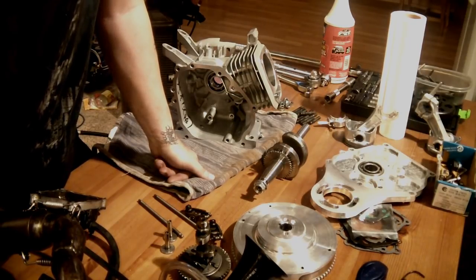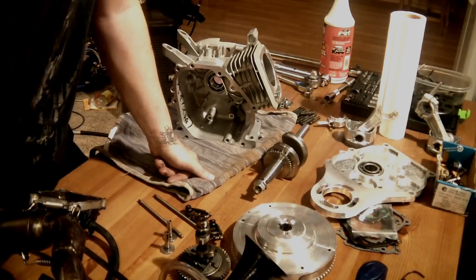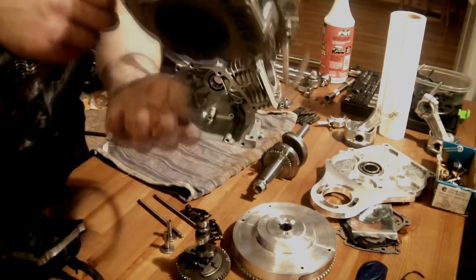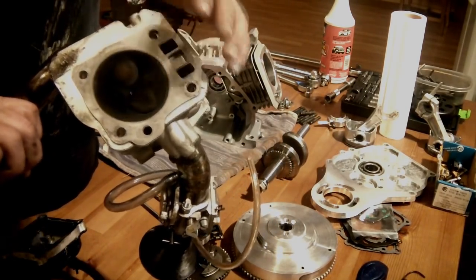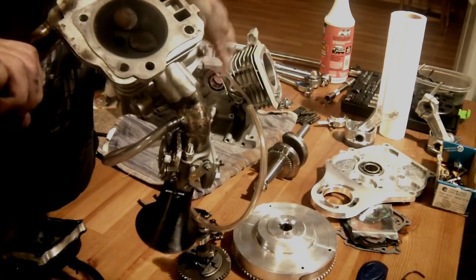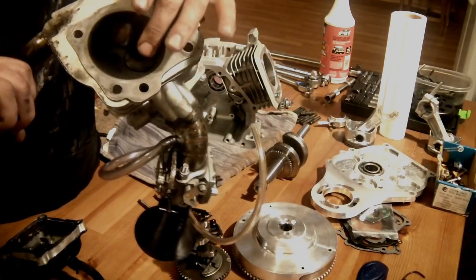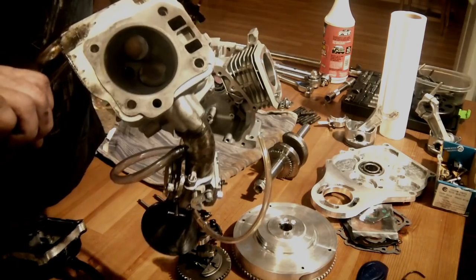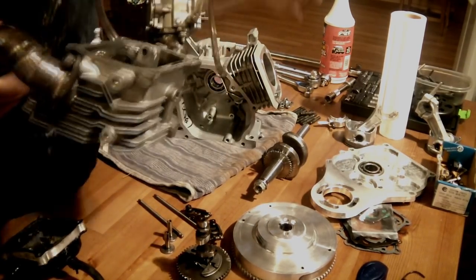It is more difficult to work with and it is more expensive to work with. This is also a big valve head, also from NR Racing. What they do is they go in, take the stock valve seats out and replace them with bigger valve seats. This is a 28mm intake valve — that is just a stock size exhaust valve for the intake — so that allows the head to flow more.